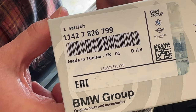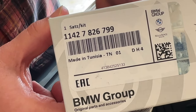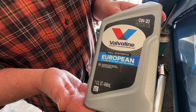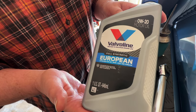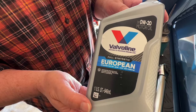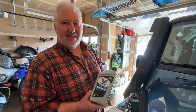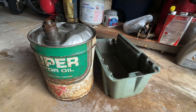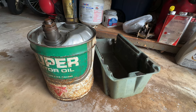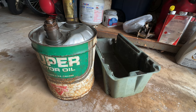The first item you'll need is an oil filter kit — this is actually the BMW kit we purchased when we picked up the Grenadier. It'll give you the part number. You'll also need a European spec motor oil: this is the factory recommended zero-weight 20 Valvoline European, and we want to make sure it meets BMW spec LL-17 FE Plus. The Valvoline motor oil I had to order from the local NAPA store — luckily it was on sale. You'll also need a drain pan and somewhere to put the used oil, like our vintage Conoco oil can.